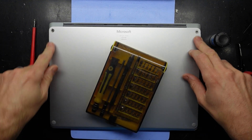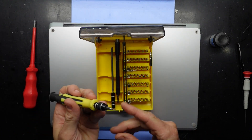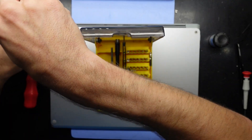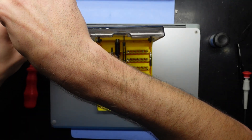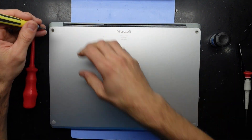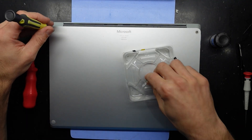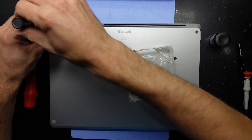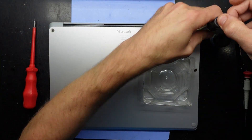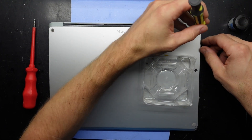To begin with you will have to take these feet off. As you can see, the previous user has already removed the rear feet for me. I'm going to use a T4 or T5 screwdriver to undo these screws on the bottom. We'll take the feet covers off, take these four screws out, and then lift off the semi-magnetic keyboard. Be careful not to damage the flex cable on the keyboard.